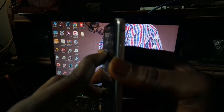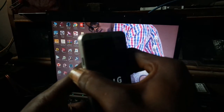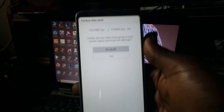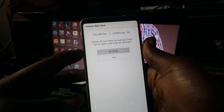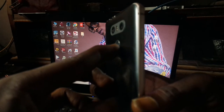So let's do it — the volume down and the power button. Let go, and then hold like this. So this is the factory reset screen. We use the volume down key to navigate to 'Yes' and the power key to select.